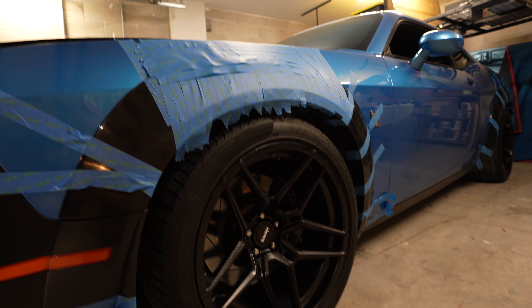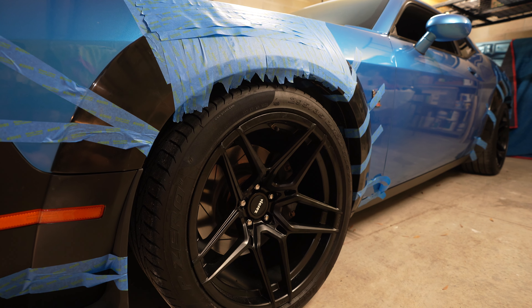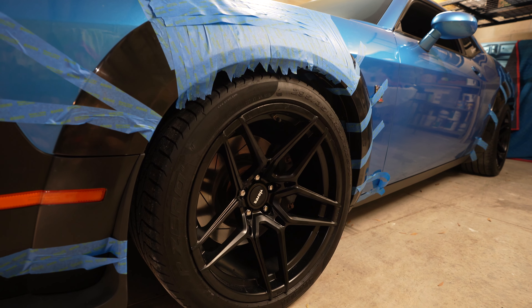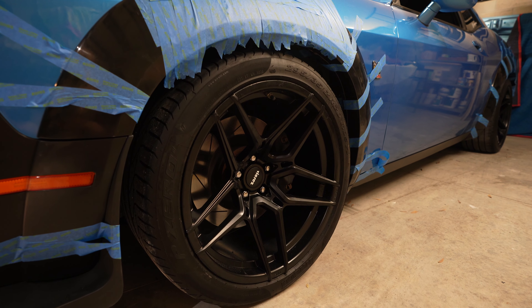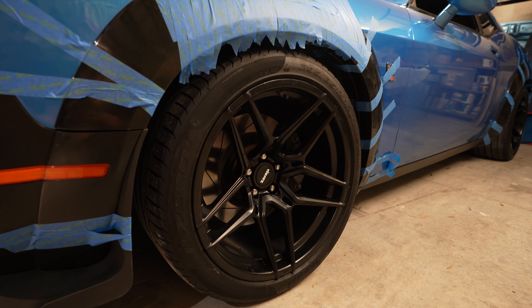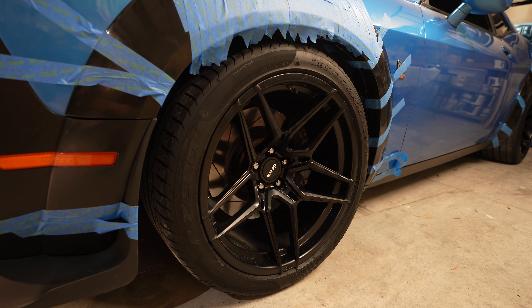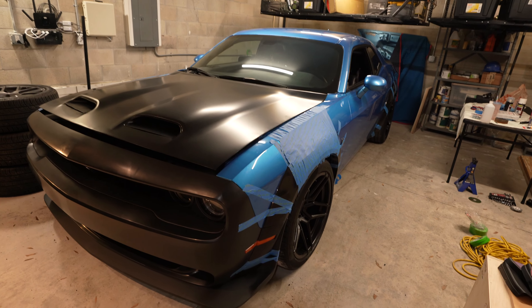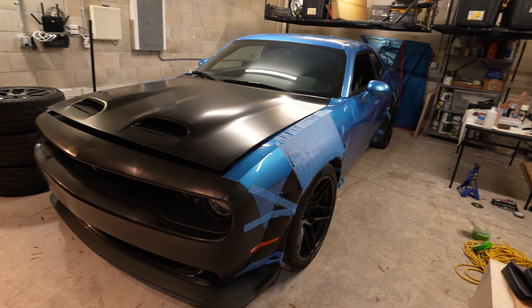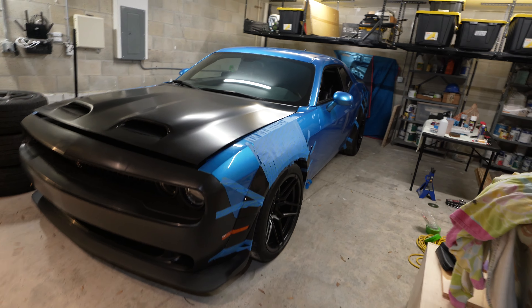The key thing about our install is we did not cut the metal fender - we only cut the plastic trim piece. I don't think we're gonna have any rubbing issues. If you order Vicrez wheels with the Vicrez wide body kit, I honestly don't think you'll have to cut the fenders like other people did. It seems like a waste of time and creates potential rusting issues. We drove around for 10 minutes and didn't rub at all. Super pleased, super pain in the ass, but we're pretty beat.